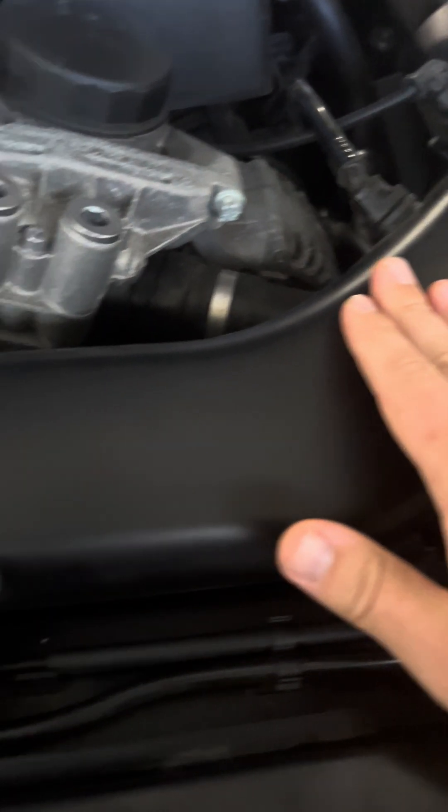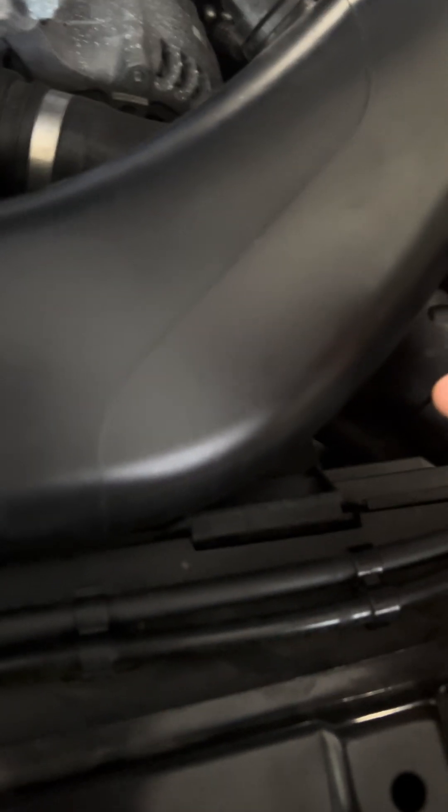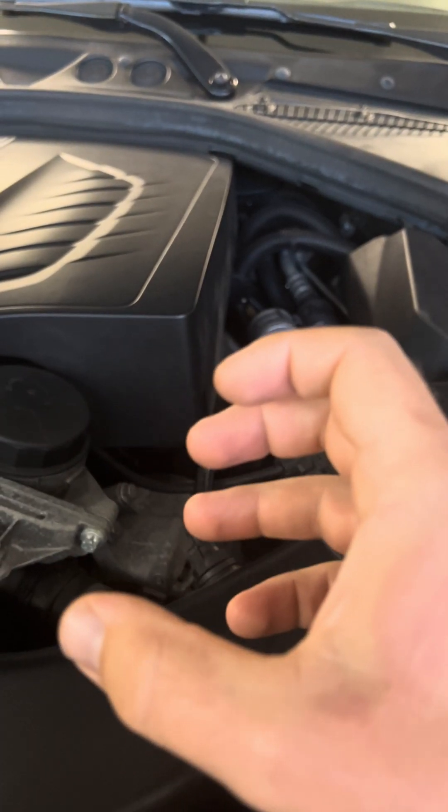With the intake out of the way, I figured if I got the radiator fan assembly up a couple inches, then I'd have the room I need to come at it from the bottom — and that's exactly what I did. Screw right here, you back out; screw down here, you back out — that's connected to that aluminum block there. Lift that up and then push it forward and it'll come off. I could never actually see it, but you can feel it; it'll come off the radiator assembly and separate a little bit.